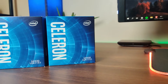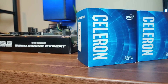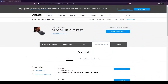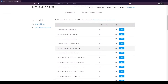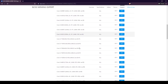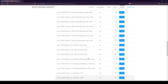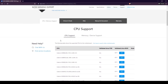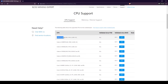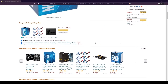After deciding on a motherboard, that helps you choose your CPU and RAM. For the CPU, go to your motherboard's compatibility list on the support page. Find the cheapest compatible CPU — usually Intel Celerons, which you can get for around $50. For the ASUS B250 Mining Expert, the Intel Celeron G3900 through G3950 are all compatible. If those aren't available, just grab the next cheapest CPU on the list.